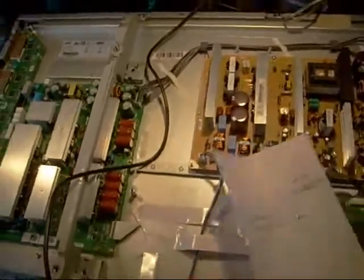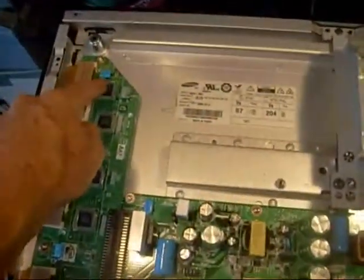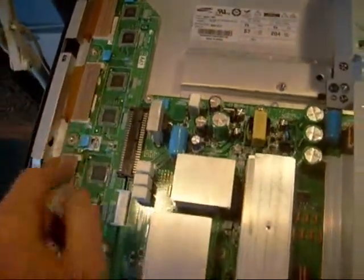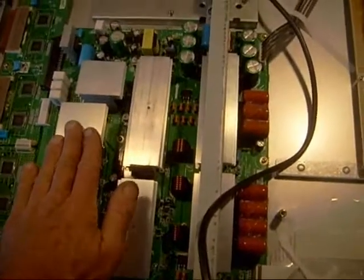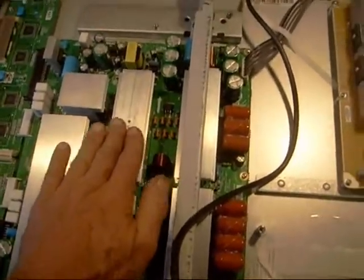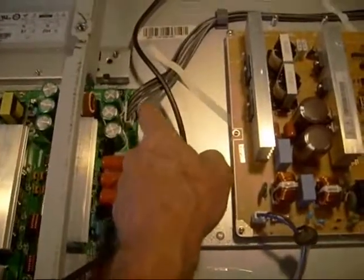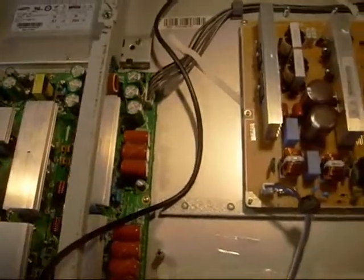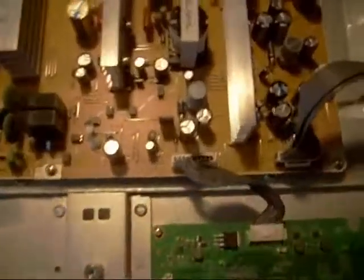Whenever I'm fortunate enough to have a friend in the business troubleshooting, I like to watch what they do. I noticed the first thing Dan did was walk up and put his finger on each one of these buffer board ICs to check if any of them were hot. They were all consistently the same temperature. He noticed the heat sinks were good and toasty hot, which means the sustain board had power going through it. There were no shorts to ground on the VS line going into the white sustain board, and we had 5 volts — or 5.3V in this case — coming out of the power supply.